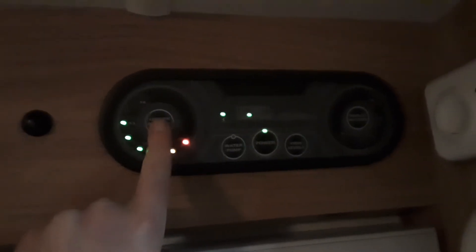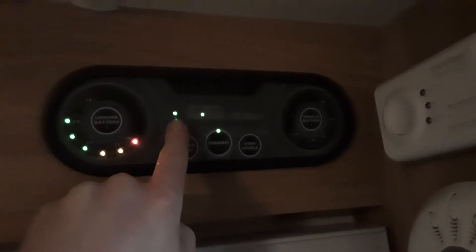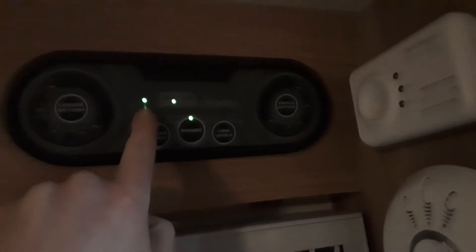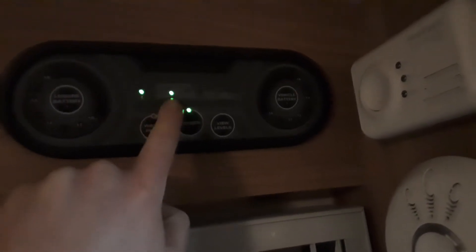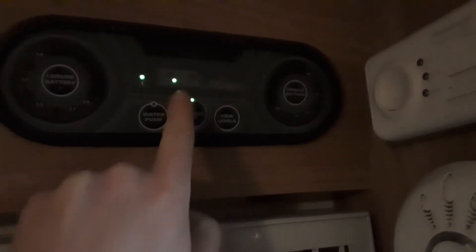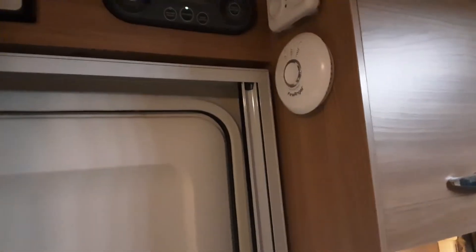Inside the van, above the door, you've got your mains power button - press it and the mains power will come on, as you can see it's already turned on. You've got your leisure battery voltage on the left hand side, which will bring up the voltage reading. The power coming into the caravan is shown at the top here - you've got the mains power post and the mains power coming into the caravan. If you connect to the car it will come up with a red light on the car and a green light on the caravan, to let you know you've got 12 volt going to the caravan when towing, which will charge the battery system onboard while towing.